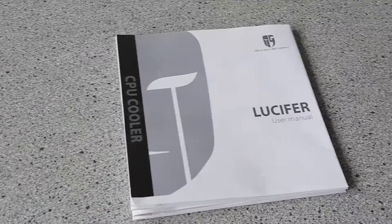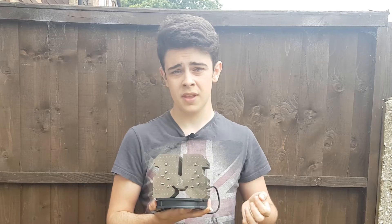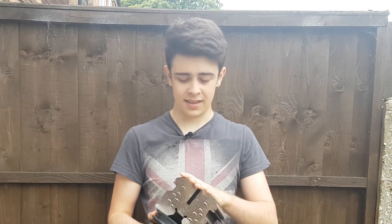Moving on to installation, for me I found it quite difficult. It took far too long for what it should have done, and there's one simple reason why. The instructions weren't very clear — not very well illustrated and not very well written either. Another problem was that Deepcool don't include any tools for installing the CPU cooler. The reason that was a problem was because you're not going to find many screwdrivers that can fit all the way through the gap to the bottom and into the screw you need to tighten to the bracket. That became quite a challenge, but luckily once I did get it installed everything went fine after that.